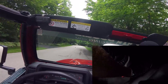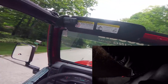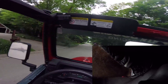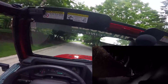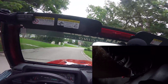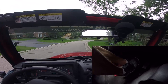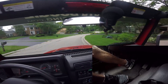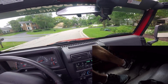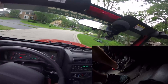This is going to be different depending on what kind of car you drive. Like most other cars, you probably wouldn't be able to let the clutch out all the way without giving it gas. But because this Jeep has got 373 gears, I've got really big tires on it, and it's the four liter straight six, so it's got more torque at the low end. It all kind of depends what kind of car it is. And all the clutches are going to engage at different points. Some cars are going to engage at the very bottom — by bottom, I mean when the clutch is all the way in, and then it starts engaging right there. Versus some cars where the clutch engages all the way at the top — meaning right near the top of the pedal travel is where it'll start engaging. So it just kind of depends on the clutch and the car.